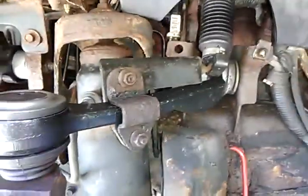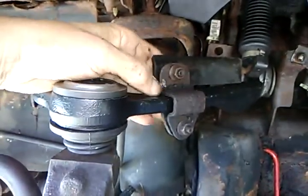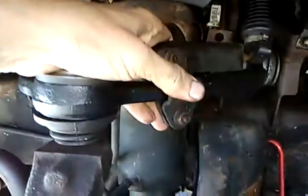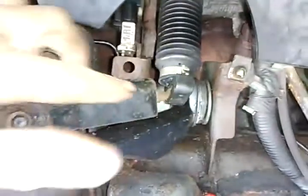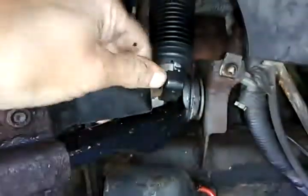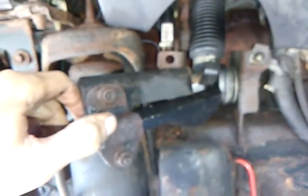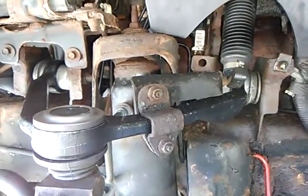Another undocumented feature: on the side of the control arm, at least on this car with the air suspension, there's this bracket. I put it on here. On my car it has a little metal nub right there and another little metal nub to tell you where to put it; this one doesn't, so you just have to guesstimate. I measured it using the old control arm. This bracket has a little pivot point — a ball and socket — that pops on, and it goes up and down depending on the air suspension to either inflate or deflate it. Okay, that's in there now.